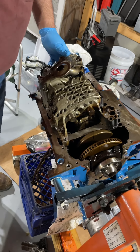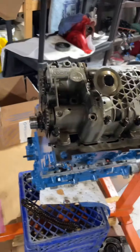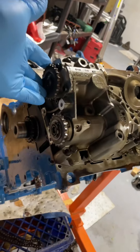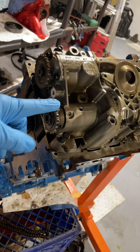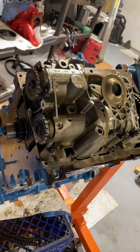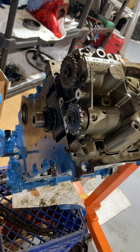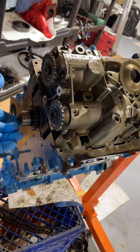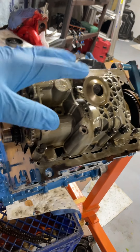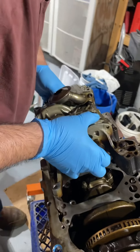This is one of the harder parts — aligning this chain on the front of the engine. You've got the oil pump here, and there's a balance shaft with a little dot on it that just wants to freewheel. Then there's the crank, and the crank has a slot. That slot goes to the top of the engine, putting it in perfect time at top dead center with the slot up. The balance shafts have to be in the right position too, so I'll show you that.